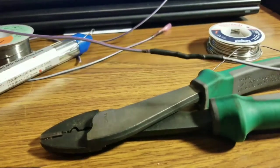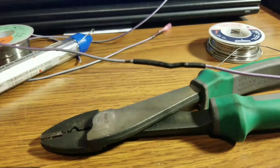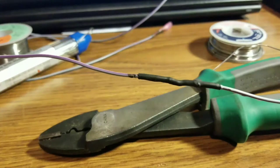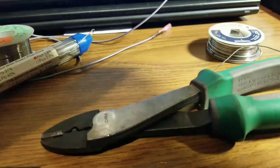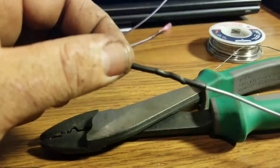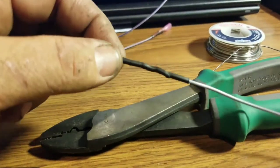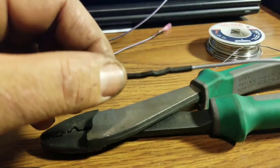Now I'm going to show my favorite — what I've been using for the past few years. It'll get you out of a job really quickly using the solder seal connectors. I know for a fact that they're approved for Nissan and Infiniti for OEM repairs of airbag and ABS harness connectors. Let me grab that connector and we'll be right back.